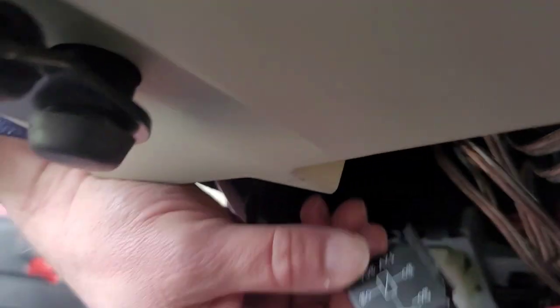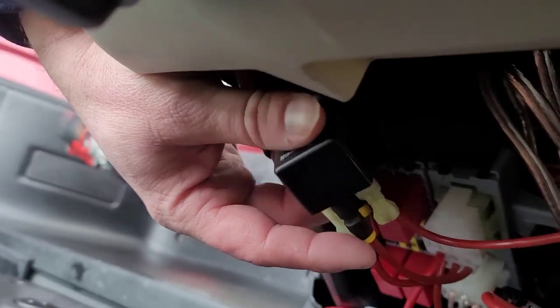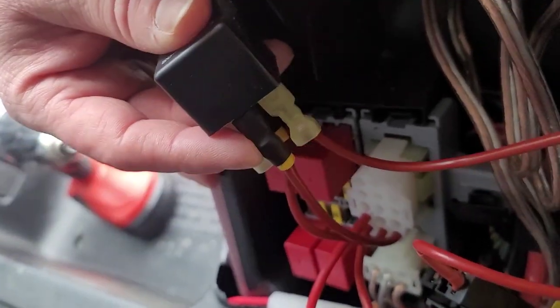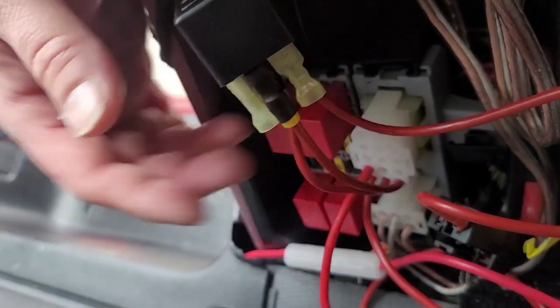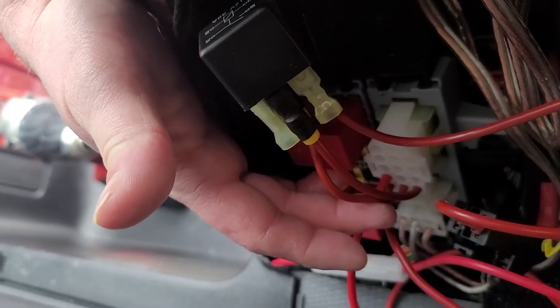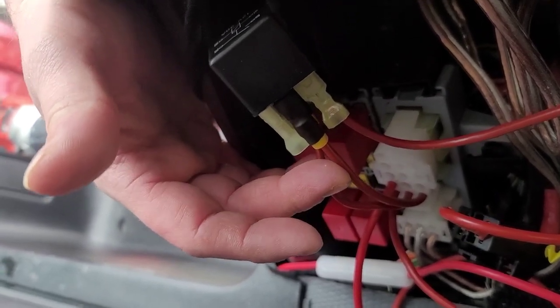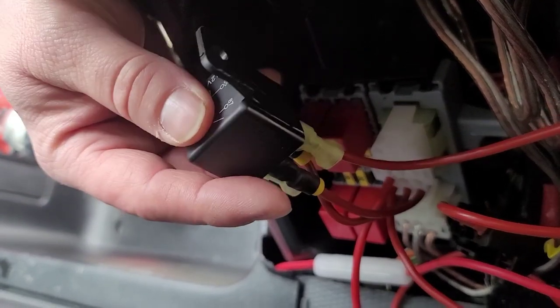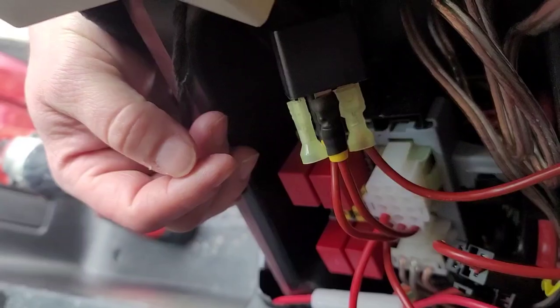You can see I've got this relay attached, and the input is coming from this fuse panel down here as it comes from the 70-amp connection. But this is triggered by the rear HVAC. I already have a full-blown rear HVAC system in here — one of these wires provides 12 volts when the key is in the ignition, and the other pulls the 12 volts to ground when you press the rear HVAC button, which triggers this relay. I don't have it hooked up to anything yet, but I'm sure I'll come up with something cool.